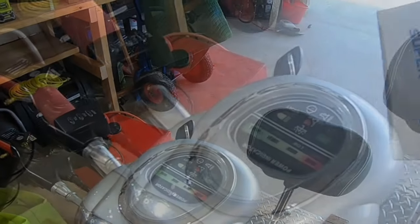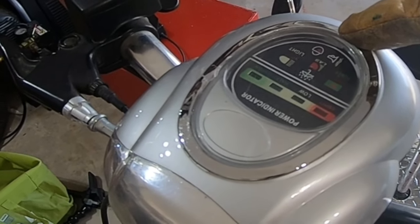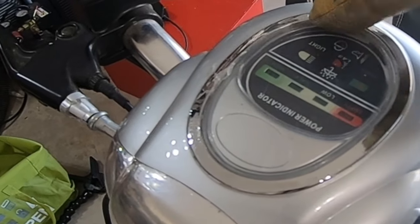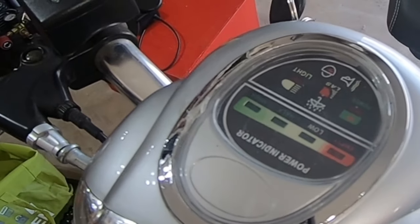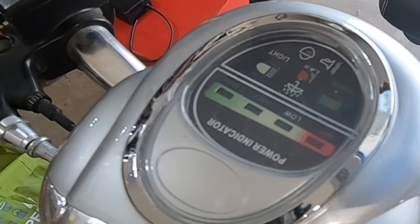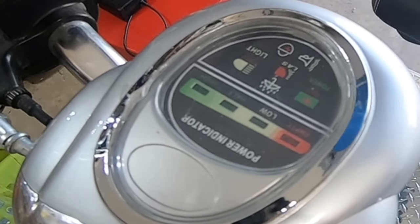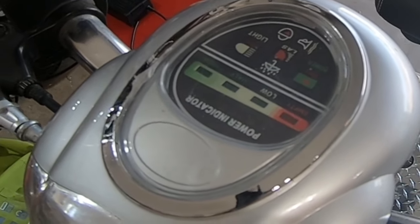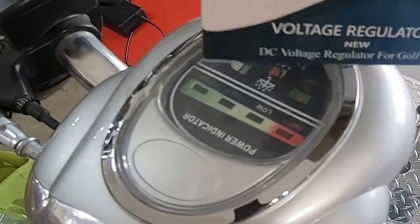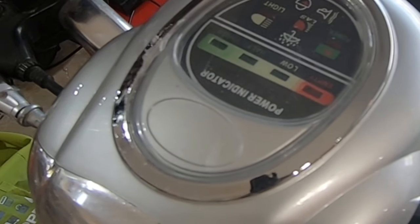To make those lights work I'm going to use a Super Knight voltage regulator designed for golf carts. It'll convert 48 volts to 12 volts. I'm going to open this up — from past experience I know I can solder a couple of wires to the positive and neutral leg, run that down into the base, and connect to it. That way the switch here will power the lights. I'll have wires running down to this and then back up to the new headlight, and it'll also be powering the new tail light and the amber marker lights. That's the plan.